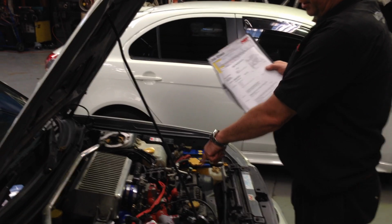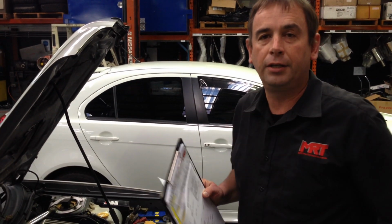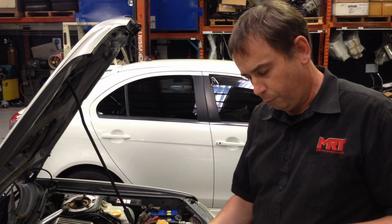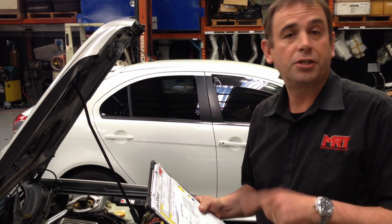This car also, some of these are starting to have problems with the factory knock sensor, which is important from an ignition control knock correction point of view, which is an input to the factory ECU. So it's got a brand new one of those. And the oil pressure switch was in poor condition, so that's been replaced.